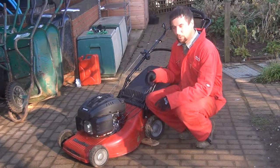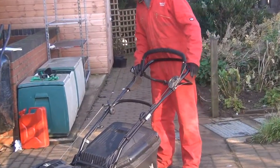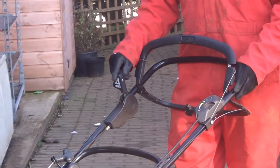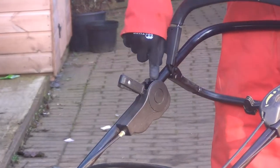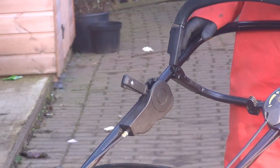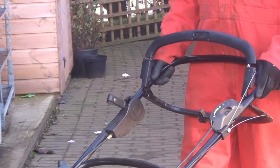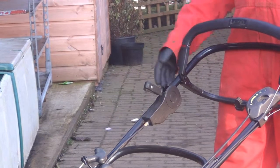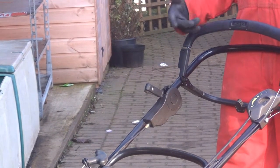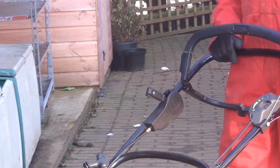So I'm happy with the fuel and we checked the oil earlier. Now we're going to look at the handles. Coming to the top of the machine there's a whole series of handles. The one on this side is the speed control — it's got four speeds, with slower speeds lower down and faster speeds higher up. You would use that once the machine is in operation based on the terrain, as it affects the pace the machine moves forward at. For long grass or uneven terrain, use low speed; on open areas with short grass, you could use the high rating.